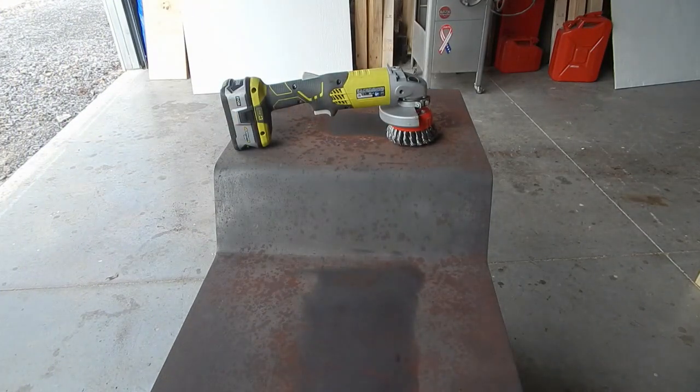Okay, basically that's what I'm going to do, and I have a metal wash I'm going to put on that, and then I'll show you the 2,000 degree ceramic paint I'm going to use. I used it on my Hooker headers on the El Camino, and it lasted for years, and those things glow, they get so hot. This should take about an hour to prep. I'll be back.